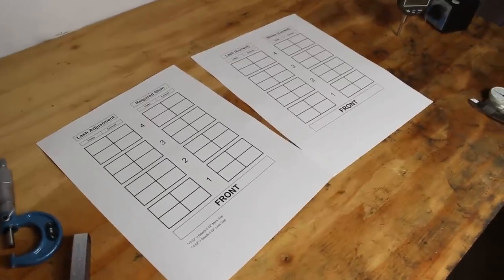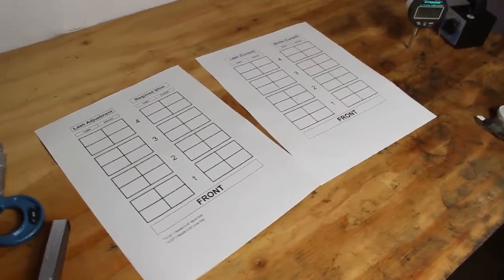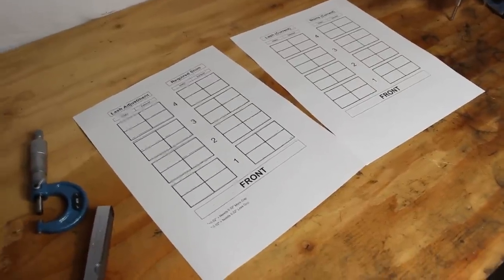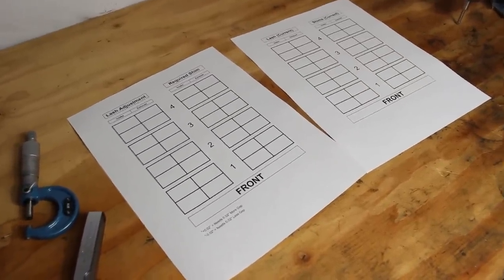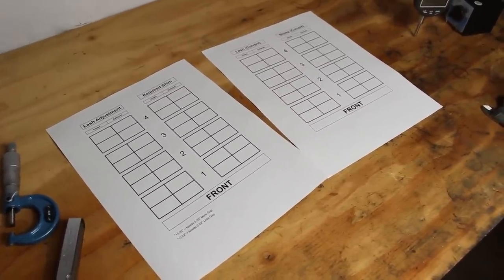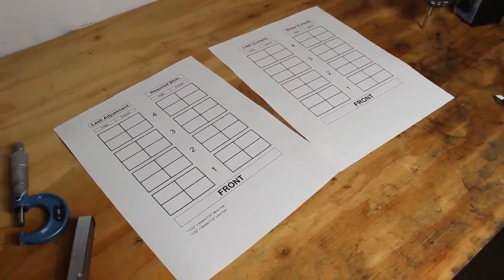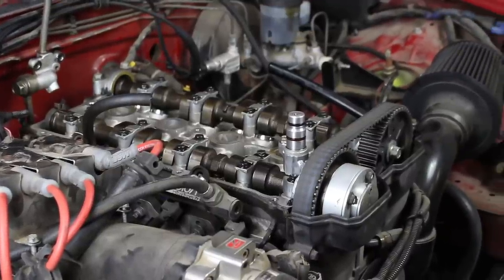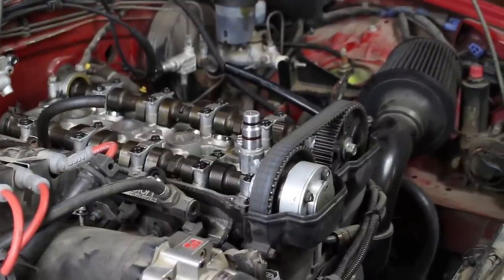It's also essential to have a way of keeping all your data very organized. This is a crucial step in the process, because if you don't stay organized, you're not going to get your lash right, and you're basically going to have to start over. I just created these charts on Google Sheets, and if you want to get yourself a copy, I'll have those down in the description as well. To get your engine ready for the lash measurement, all you have to do is remove the valve cover and put the transmission in neutral.